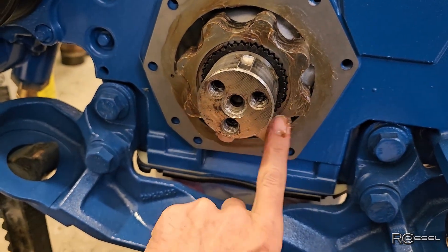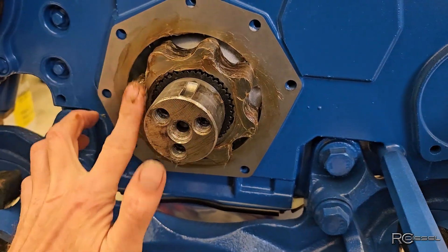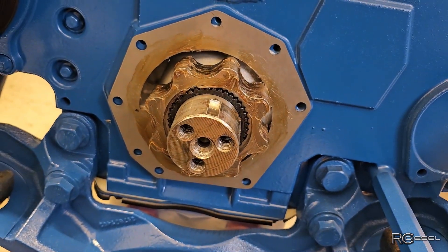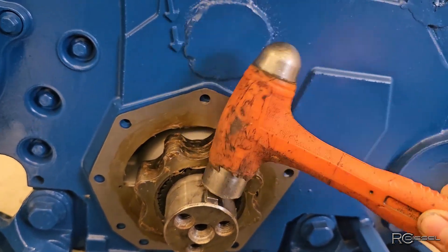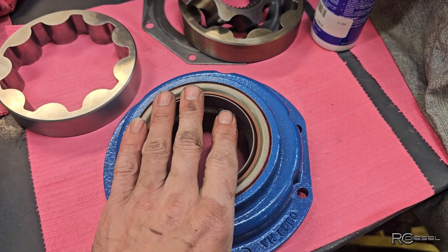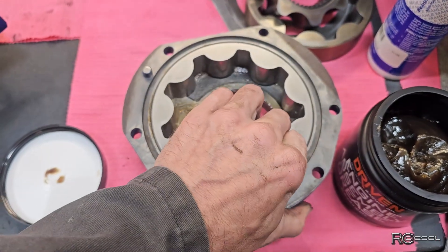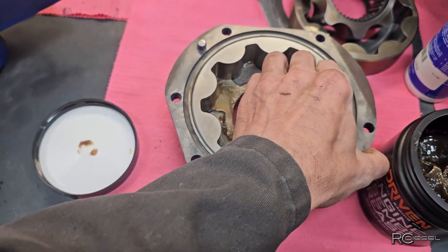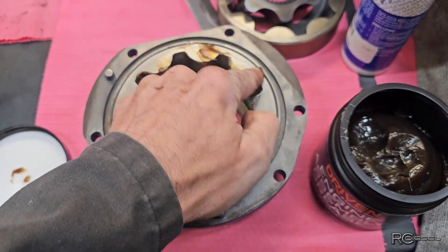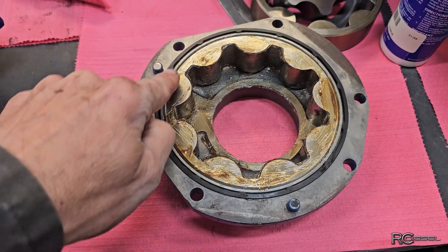Another reason I like to use grease on the oil pump is because the grease is very thick and it helps seal all of the sealing surfaces. It really draws the oil up quickly - if you can draw a hard vacuum, grease seals it and helps that happen. So we'll drop our drive key into place for the dampener. We have to press our new seal into the housing - this one has Loctite on the outside so no retainer needed, just press it in, lube the inside with grease. Take the new inner rotor and drop it in, then give some grease in between all the lobes too.